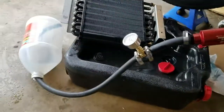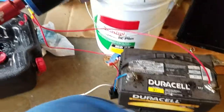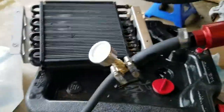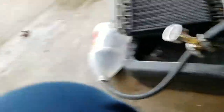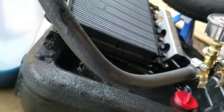I've got everything together for a little control test. We'll just see if the system builds any pressure on its own. I also added a relay to the fuel pump setup, so it's a bit less sketchy. Perfect — nothing, no pressure. You can see it's just flowing like mad in there and about to get all over my garage. So there's no pressure in that, and it is flowing like a beast.